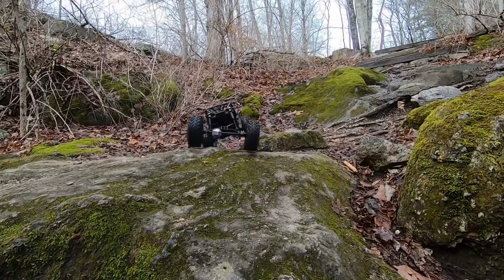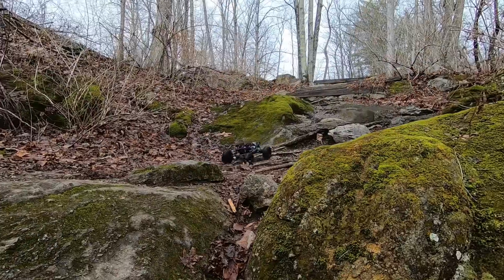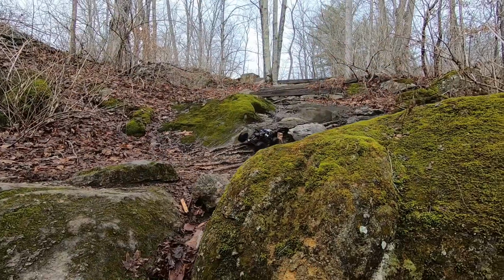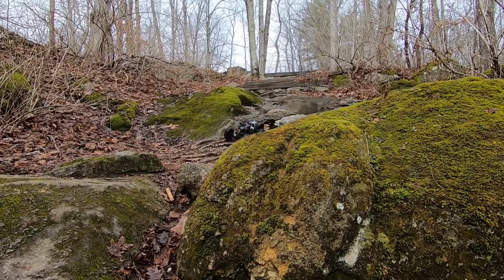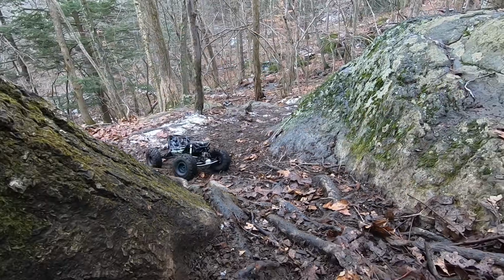What I would like to do is actually add some drag brake in the profile. There's a lot of roll, and I think with just a little bit of drag brake added into it, it'd be much more manageable to drive. And there's a little bit of cogging on the bottom end. If you're looking for that smooth throttle feel, it's a little jittery just at the bottom, but the power band on this is absolutely incredible. It's just a wild machine to watch.